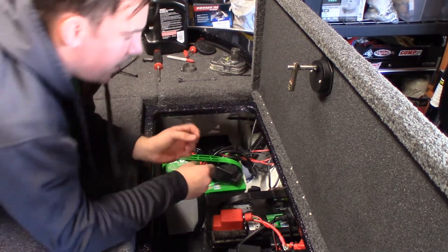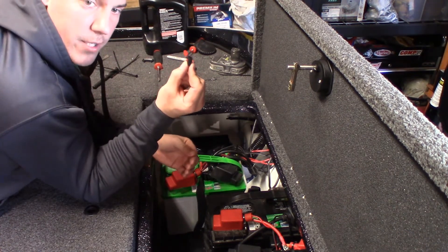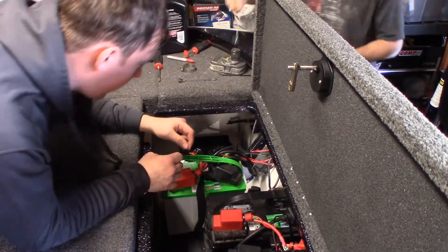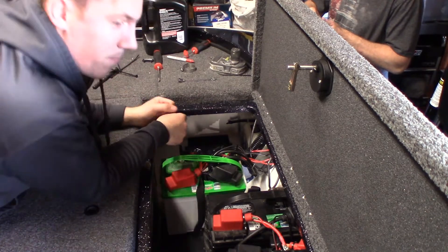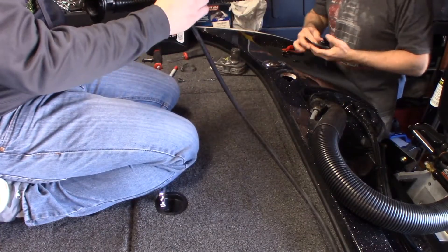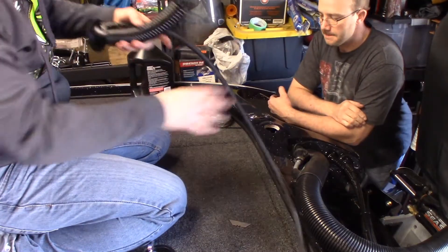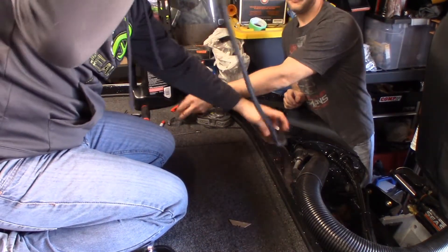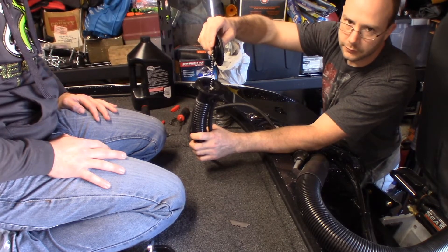One thing I forgot to mention — very important: the pressure hose that we pulled off of the oil tank has a little black cap that you want to replace where it came off, so don't forget to do that. Next, we're going to cut the length of our hose. We have it seated down so we can get the proper length — make some marks, then pull it back out and cut it to length because you don't want any excess. Before we put this back in, the last thing we want to do is reattach our tether in case that screw falls in so it doesn't go into the oil tank.